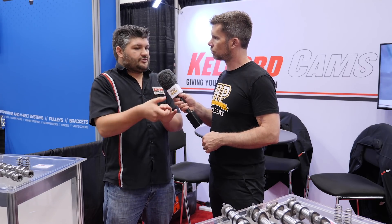In this engine the exhaust is like a conventional camshaft on a rocker arm finger follower. On the intake system there is the same finger follower, but rather than the cam running along that, there is an intermediate rocker shaft that's controlled by an eccentric shaft that the camshaft then rolls onto. So while the engine's operating and idling, they don't run the throttle — the valve lift will only be opening the valve a tiny little bit. As they advance or move the eccentric shaft, it changes the rocker ratio, so you're getting lift and duration increasing as it changes the arc that the intermediate rocker sweeps through.